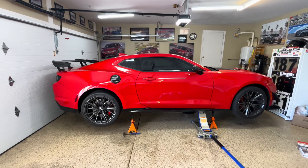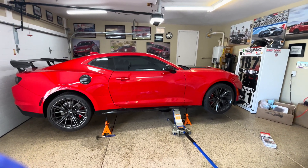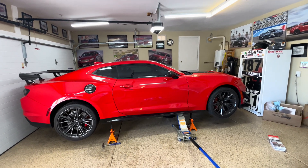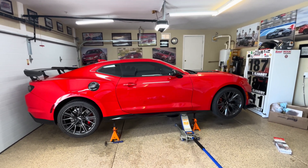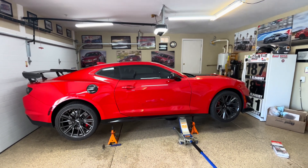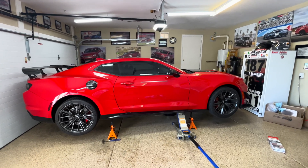All in all it wasn't a very difficult job. The one thing I'd give people a heads up on: be careful when you're torquing the bolts for the pan because I over-torqued one and one of the 16 pan bolts broke. I'm going to drill that out and have it replaced — no big deal, it's not leaking even as I'm idling it, but I will get that addressed.